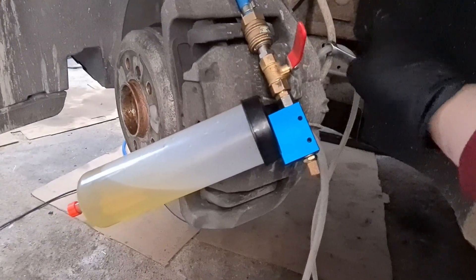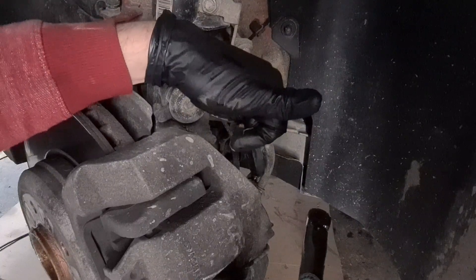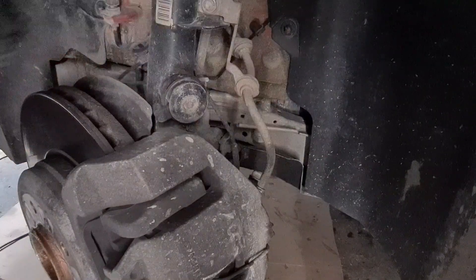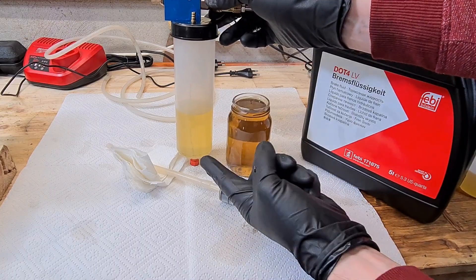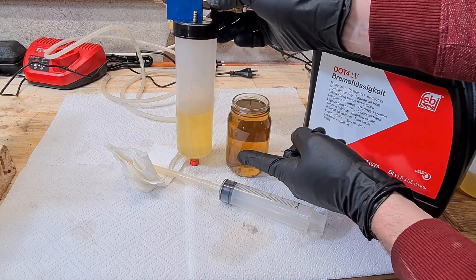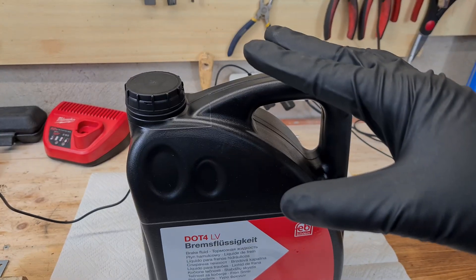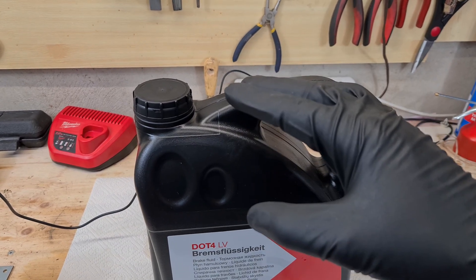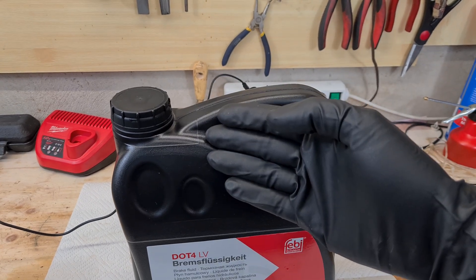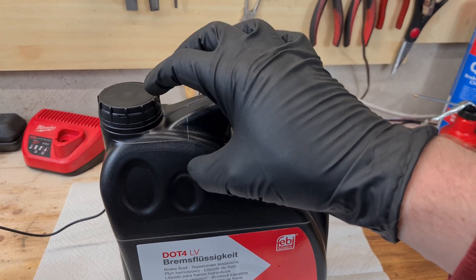Let's remove this. The bleeding nozzles have to be torqued down to 15 Nm. Here I can compare the color of the new fluid and the old fluid — the old one is pretty dark. It's not that bad, but it was definitely due to be replaced. You are going to need about two liters of fluid to do the flush, and also make sure you are using a fresh new container that is still sealed, because after a while moisture from the air gets into the brake fluid and it's no good.